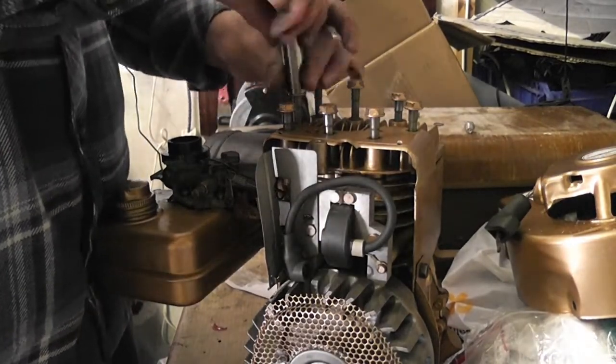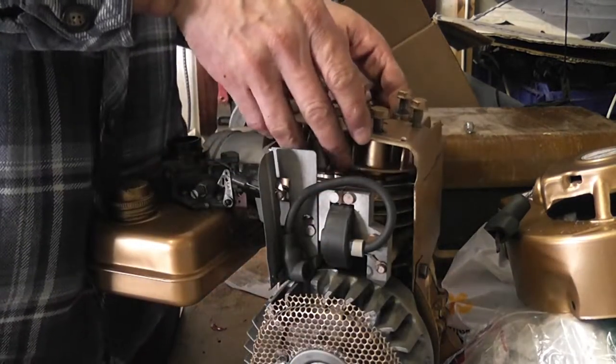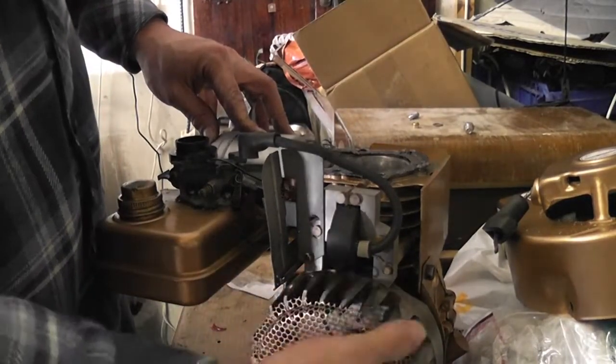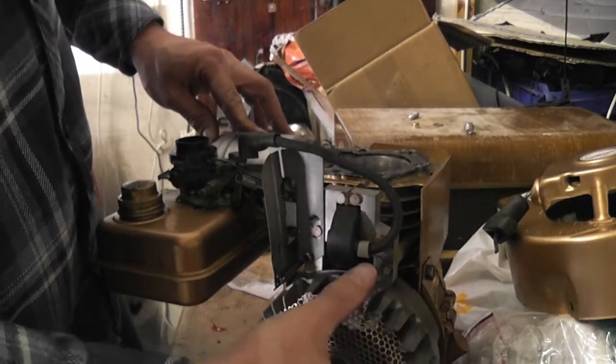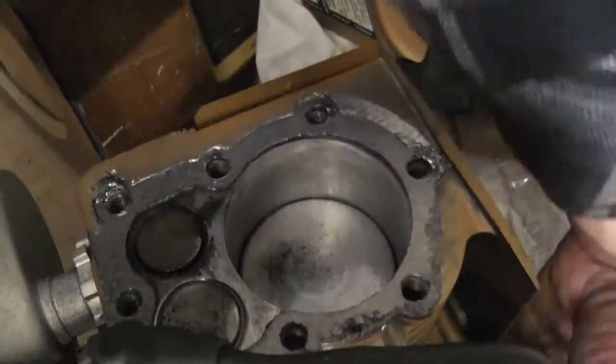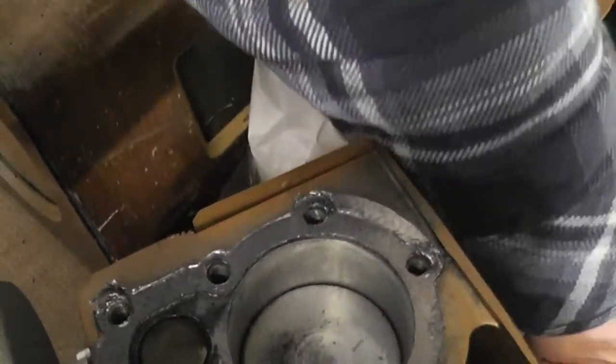I'm hoping now when I take the head off that the engine rotates freely. I think we're going to be opening the crankcase, folks. There's nothing untoward in the top end. I'll get you set up here so you can have a look and see for yourselves. So as I turn it, it stops there, and in either direction it doesn't want to move past that point.